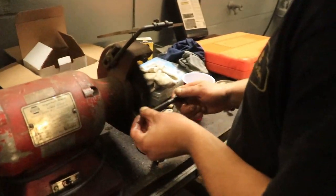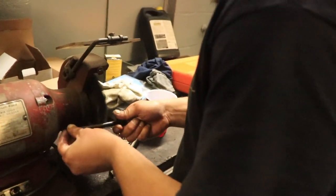That's crazy. Yeah, so don't forget to clean your bolts up before you put them in. And when you go to torque them down, you have to use assembly lube. Because if you put just oil on the threads, bolt heads and bolt washers, then you will not get the proper torque spec. So we are going to get the assembly lube over here somewhere.